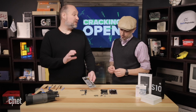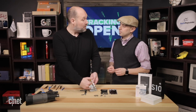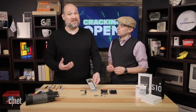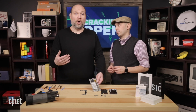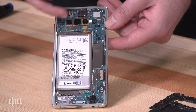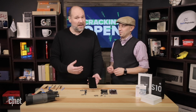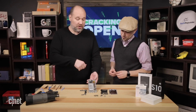The larger battery is now fully visible. The one component they weren't able to examine is the ultrasonic fingerprint sensor, which is located behind and below the battery. While the battery is technically removable, it's held to the frame with very strong adhesive and — unlike some phones — the S10 does not have pull-tab adhesive strips. Removing it would require heavy prying with a real risk of puncturing the battery, so they leave it in place. This also means they can't remove the new Infinity-O edge-to-edge display, though that could be done if the battery were failing or the display were cracked.